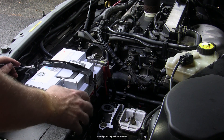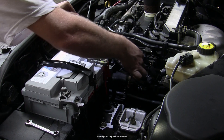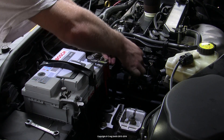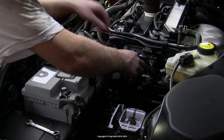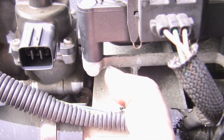If you do clean the valve out to make any sort of mechanical difference, it's a good idea to reset the ECU's Keep Alive memory so that it really re-learns things. Leave the battery disconnected for the duration — that's the best approach. The EGR valve connector just unplugs with the depression of its little tab, and then get the bolts out by fiddling with them.